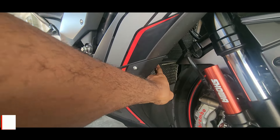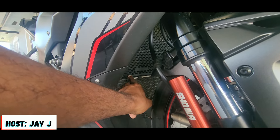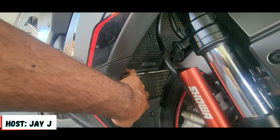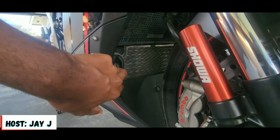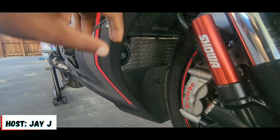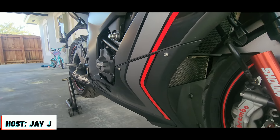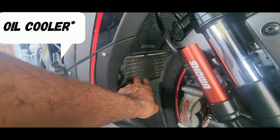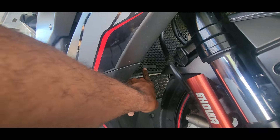Okay YouTube, in this video we're going to replace the radiator guard at the top because it was installed wrong when I got it. I purchased the wrong size radiator guard — I only purchased the one for the top part — and now I purchased the right one so the top and the bottom are both going to get replaced. Then the horn is going to be installed a lot better. Right now it's up against this part of the fairing and when you blow it, it doesn't go as loud as it should. So to do this you have to take off the whole bottom belly pan, install the radiator guard properly on top and bottom, and then the OEM radiator guard comes off and there's another one that goes in front of it. It's actually going to say ZX10R right here on the radiator guard.